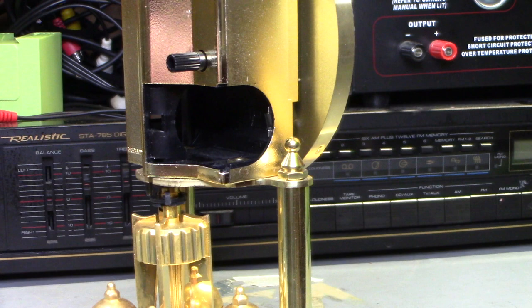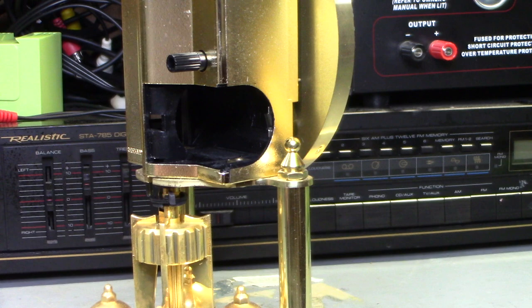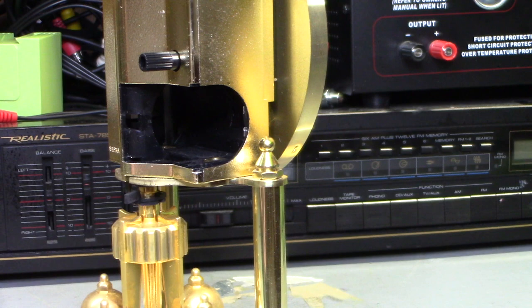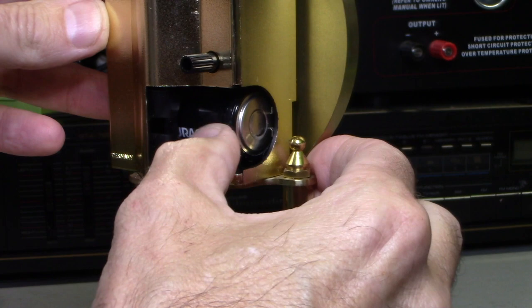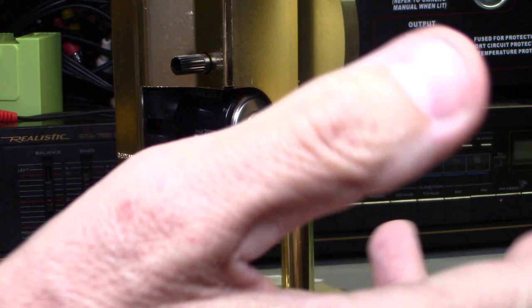So that's all you have to do — basically put a battery in. It doesn't run, people sell it cheap, doesn't work. All you have to do is clean the contacts with a little bit of sandpaper. Literally a small piece of sandpaper like this — you get inside, you clean it, you clean this contact over here, just rub it against it. It could be a little bit of dirt, it can be anything — it's just a poor connection. They're very, very sensitive, these clocks. Another trick I do: you can twist the clock battery like this — it helps make a better connection.